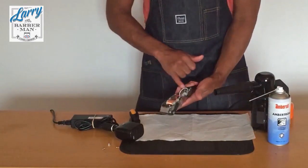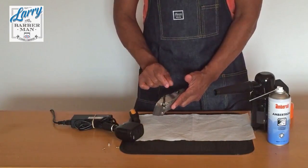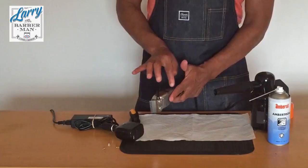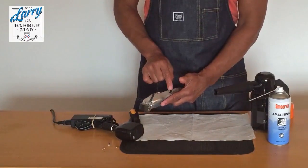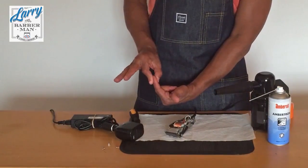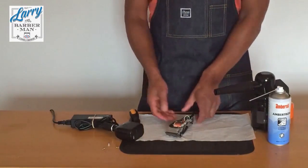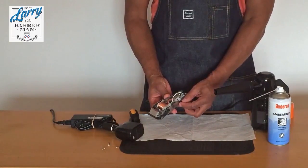This here is the switch. The switch has very fine holes and, owing to the business that you're in which is cutting hair, these fine hairs can sometimes lodge themselves in the switch. When hairs lodge themselves inside the switch, the hair breaks the contact between the two conductors which causes the electricity to flow through the machine intermittently. That was where I suspected the fault to be.